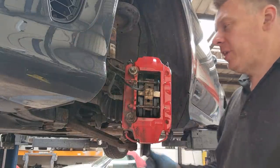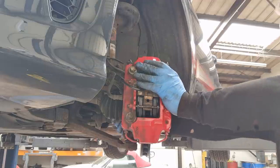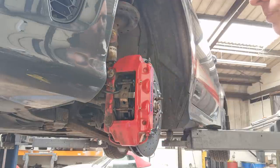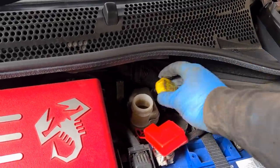Spin the disc to make sure nothing's catching — it isn't. Then we are all done, we can put the wheel back on. Now just pump the brake pedal a few times to get those pistons back into position. The final job is to check your brake fluid — make sure it's not too low or too high. So there we go — that's how we change the stupidly expensive front brake discs on an Abarth 595 and 695. It's also pretty much the same on most Brembo brakes, so you could use this guide for plenty of vehicles. Thanks for watching — don't forget to hit that like and subscribe button and I'll see you in the next video.